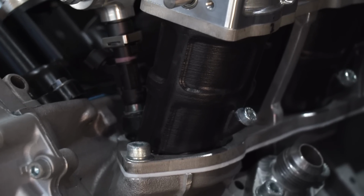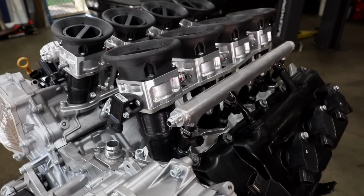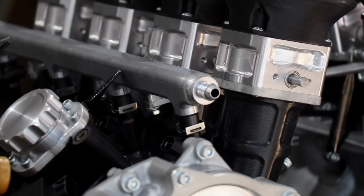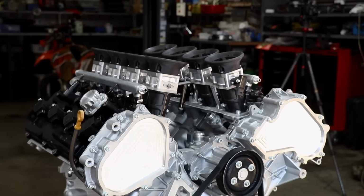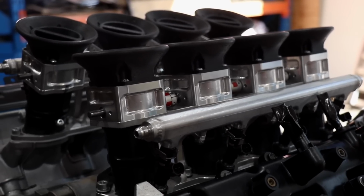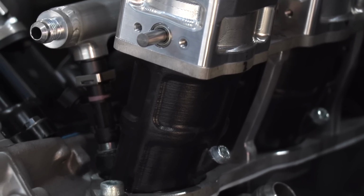inlet manifold. These are actually 3D printed from a carbon fiber reinforced nylon. It's obviously not the kind of stuff that you make dick and balls valve caps out of. It's high-end stuff and was made with a very expensive machine. And it's also of Nelson's own design as well, so he's a bit of a thinker and he likes to look at doing things different ways. Beauty of stuff like this is very light, it's very easy, it's a lot less wasteful than machining aluminium, and it's also got your heat properties of taking heat out of the throttle body from the engine.